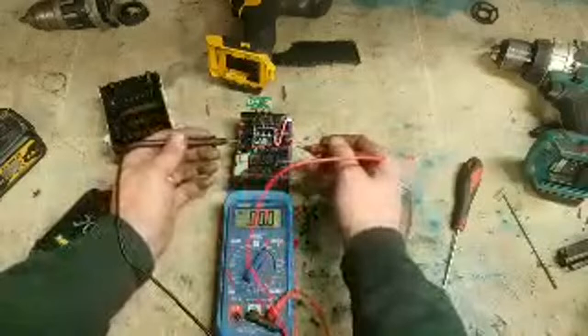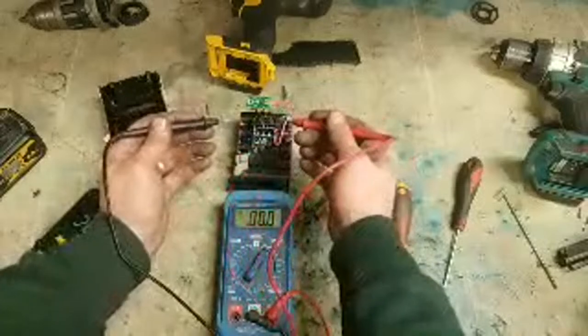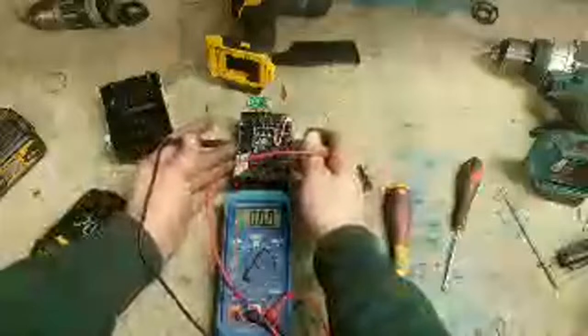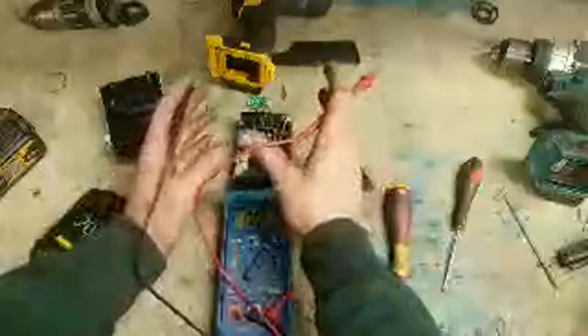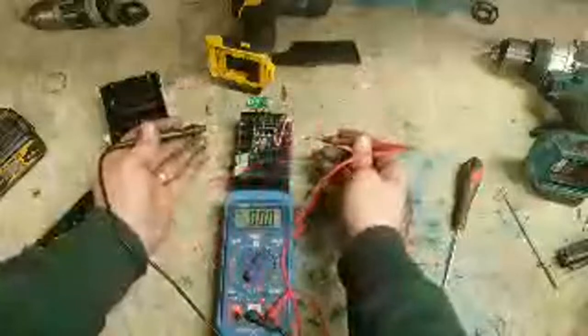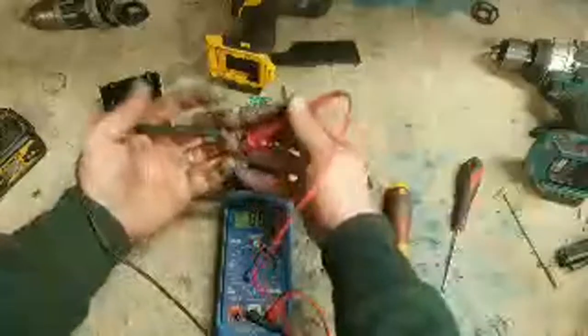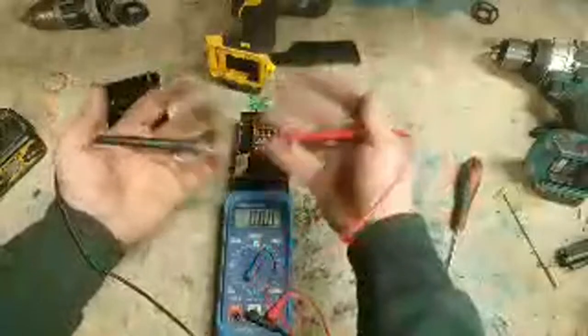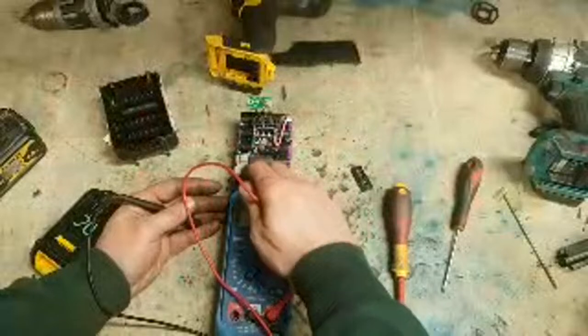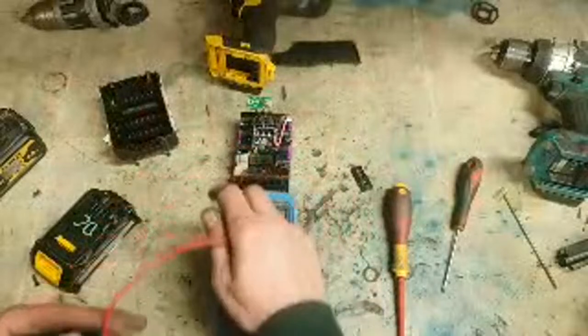These fully charged should only be 4.2 maximum. Once they go over, they go over voltage. Once they're over voltage, they're volatile as hell. Anything can set them off. Once they're over voltage, they can go into thermal runaway, self-ignite, burn the house down. Just type in lithium battery burning, and you'll see what I mean.